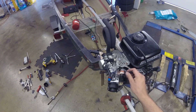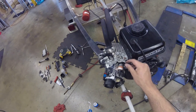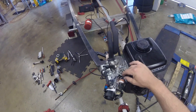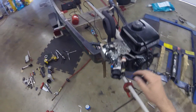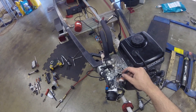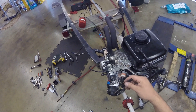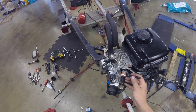I ordered a GX270 carburetor and the 390 adapter plate. The back plate is thicker — it's a 15-degree plate that angles the carburetor for use with an angled motor plate on a go-kart. Since we're keeping it straight on a mud motor, I used the second adapter to straighten it out with a little Permatex in between. Then you use your GX200 studs, put the carburetor on, and put the velocity stack on.